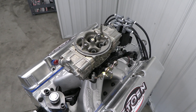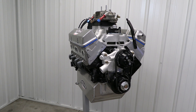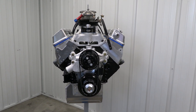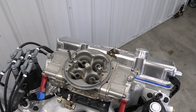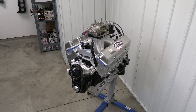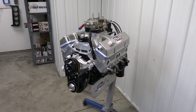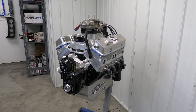The last thing to go on before heading to the engine dyno is the Holley double-pumper four-barrel carburetor, sitting on a one-inch open spacer to help improve signal to the venturis. This carb is sized at 850 CFM, but Jamie works with a specialized carb builder to build several options with different venturi sizes depending on track and conditions. It isn't unusual for teams to travel with maybe five different carburetors and swap them out depending on weather, track conditions, and even the race car chassis setup.